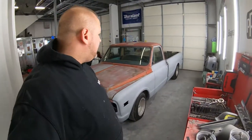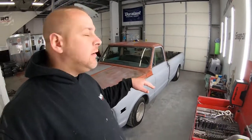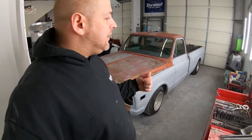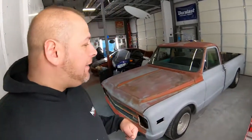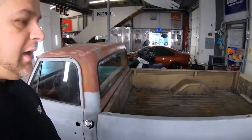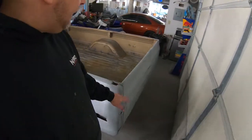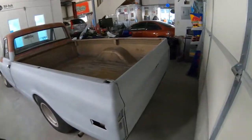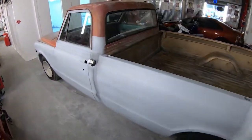So it's a 1968 Chevy C10, long bed, two-wheel drive. It does have a factory four-link suspension in the back, but somebody took the springs out and put in some airbags — it seems to ride okay. There are valves inside the truck bed itself that I'll probably relocate — a valve on each side that controls each bag. One had leaked when I got it and I fixed the leak, and it's been sitting for about eight months and they are still sitting perfectly, not even leaking. So super pumped on that. Tailgate opens and closes just fine.